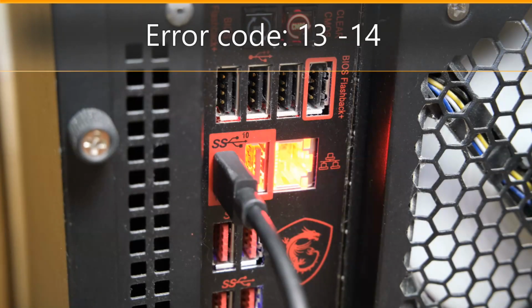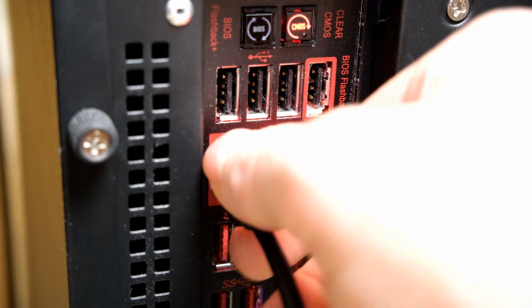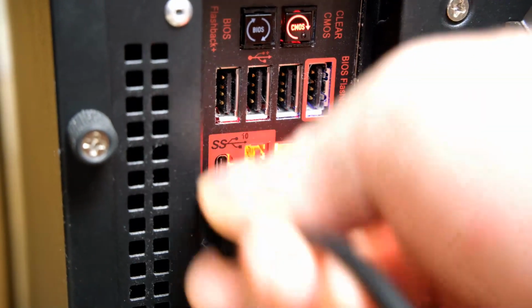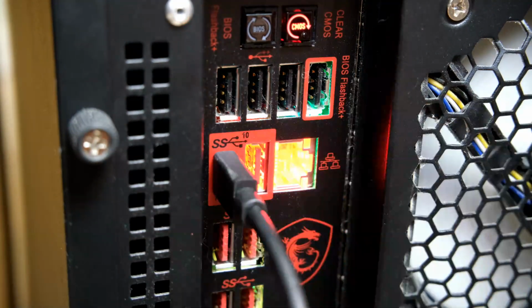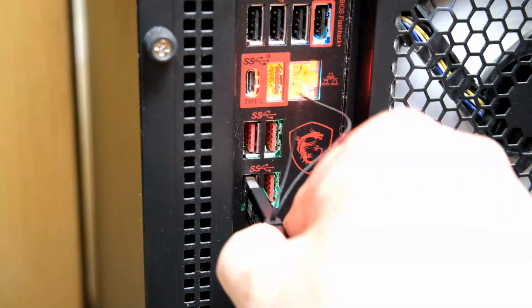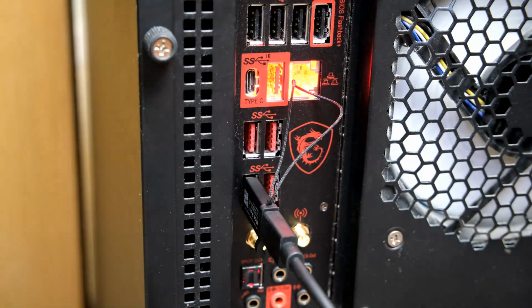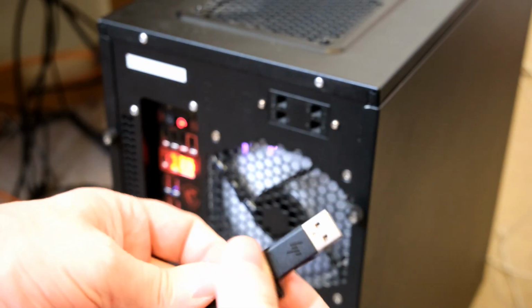Sometimes during the resume process, the graphics card cannot establish a connection, so unplugging the USB Type-C adapter from your PC and plugging it back in may help re-establish the connection. Alternatively, just use the supplied adapter and plug it into a USB 3 port instead. To be honest, this seems to be a more reliable way anyway.